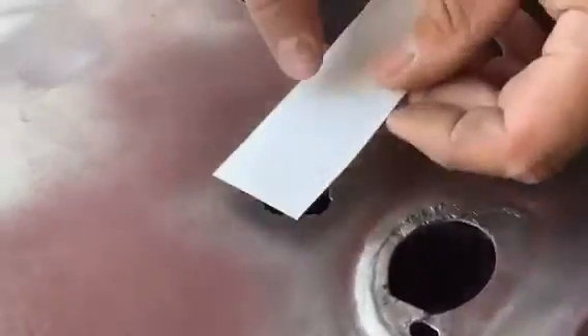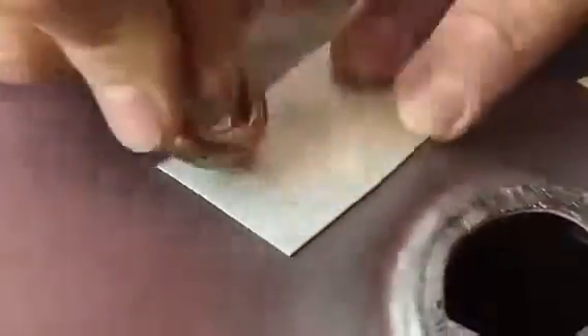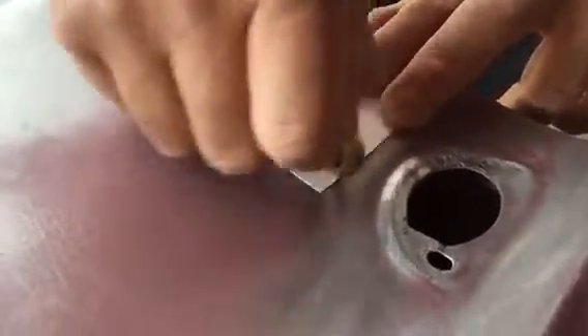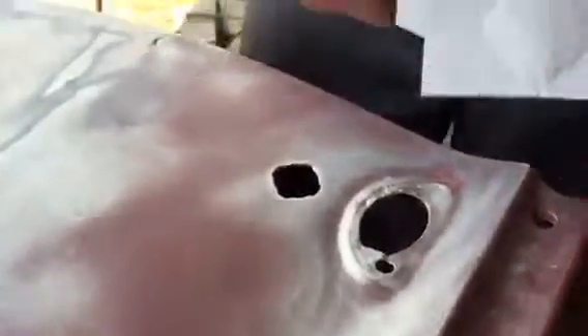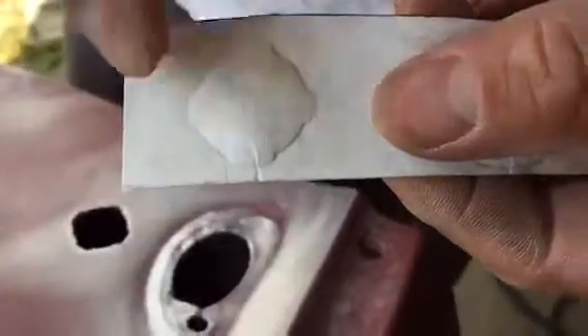Okay, HQS Customs here. I'm going to show you how to make a template to cover that hole up. Get a piece of paper — this is kind of thick. All I do is put it over it and rub it across in an X pattern. This is just in case you can't get it from the back side to mark it, but this is another way. You see that? It's perfect. So you cut that out of the sheet metal, put it in there and weld it in.